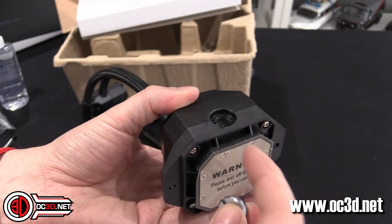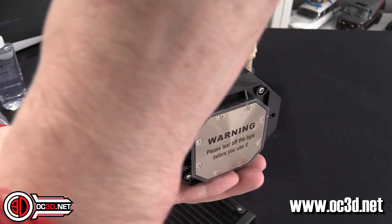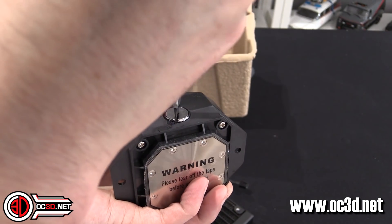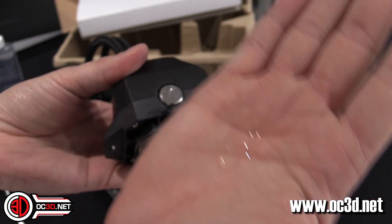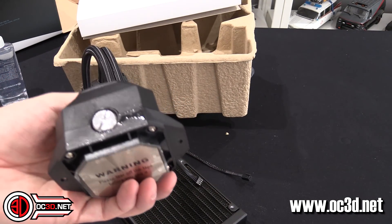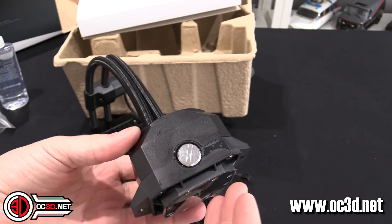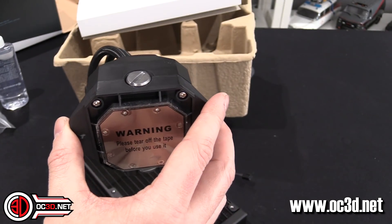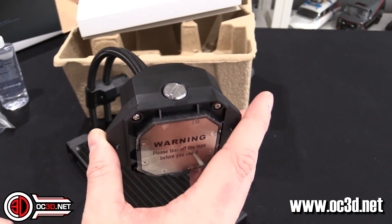I was a little bit concerned, but it is full up already — you can see the water in there — so the coolant must just be in case there are airlocks or it evaporates over time. By taking the top off, if you use this at home, you can get a little water coming out, so I'd advise keeping paper towel around to mop up any leaks. If you do get any leaks, turn your system off straight away, because water can conduct between the pins and cause shorts.